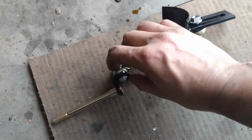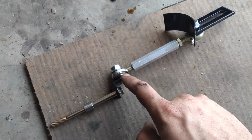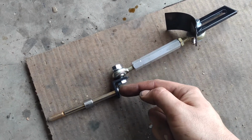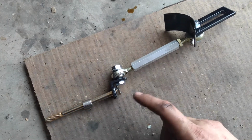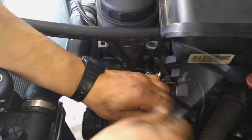Now mount the L-shaped bracket. You're going to be using that long 10mm bolt. It has a spacer on it. The tilt bar is going to be used to basically adjust the camber of the supercharger. Depending on your vehicle setup, it may or may not need to be used, but we need to install it now in case you do.